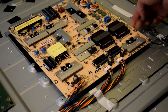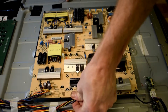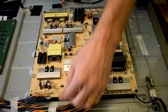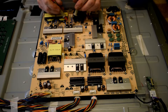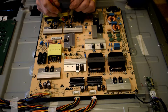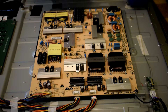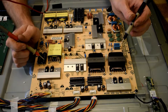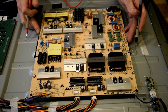My first thought was it's not having any power, so let's have a look. I disconnected everything and unplugged the TV. I'm going to use my multimeter and test all the major components. The very first thing I checked is these black components — the MOSFETs on these heat sinks. Using your multimeter in continuity mode, just make sure that there's no short. If there's no short then they should be good, because those are either diodes or MOSFETs, and both of those components should not be shorted. I tested them out and they seem to be okay.